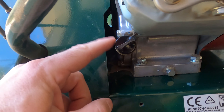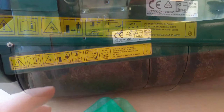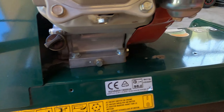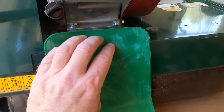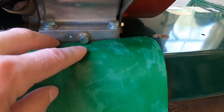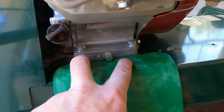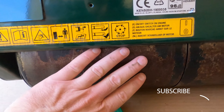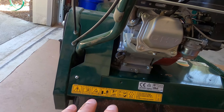There's also a fill station on the back side, identical to the front. So what I'm going to do is take this off and the oil will drain down and into my reservoir. I have a funny story here — I drained this after the first five hours of use like the owner's manual says, and I used a flex funnel — it bends because it has lead inside the rubber. I laid it up there to hold it in place, but it slipped, and oil ran all down my roller. Oil just got everywhere, so I'm going to try to alleviate that in this video.